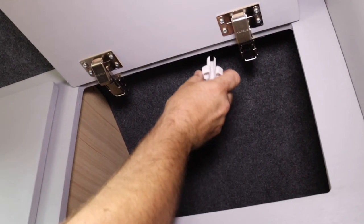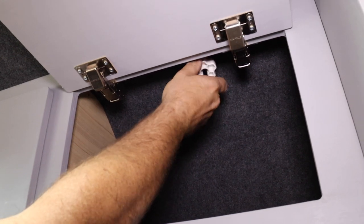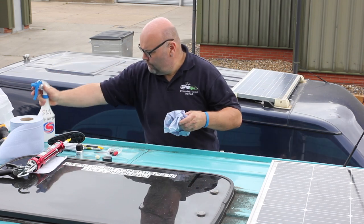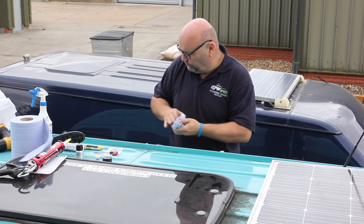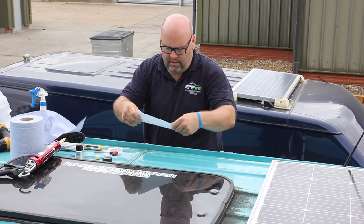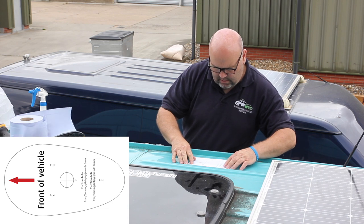Tony now checks the likely position of where the clamping tool, which is designed to give a secure and watertight installation, will be attached once the mounting foot has been installed. Next, using a mark he made on the roof light, Tony chooses the optimum location on the roof for the antenna. He is limited in where the antenna can be located by the roof ridges, but knows that by placing it between them, the cables will still come down into the cupboard below.